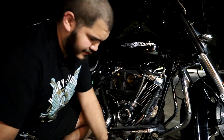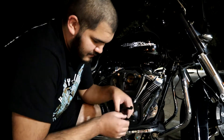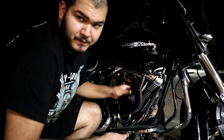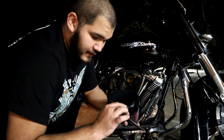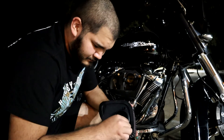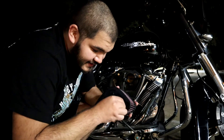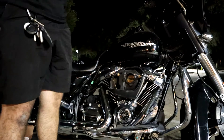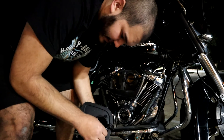When you have your new filter, you're going to want to clean out your oil return hose. Mine is really clean since I've done this before, so it's not too dirty. Take your new filter - whether it be the K&N high flow or just a stock filter - and feed that oil return tube in there. It's going to be kind of tight, so just make it work and feed it in slowly; you don't want to rip anything.